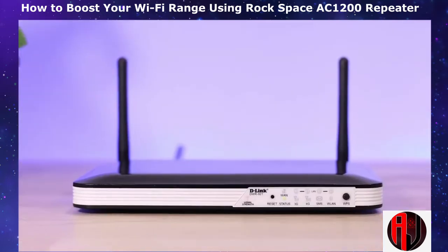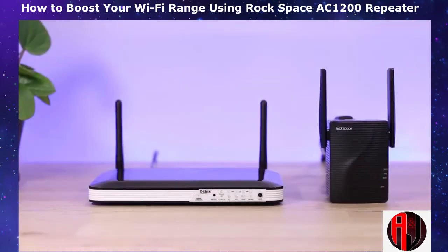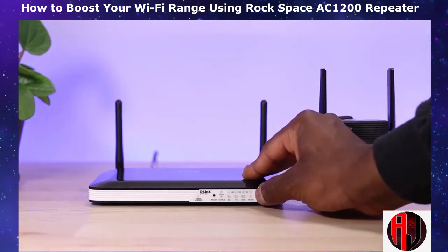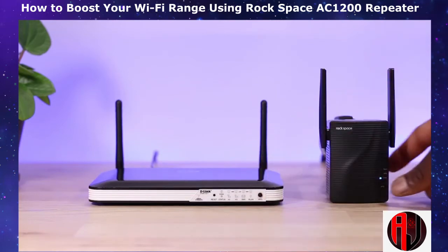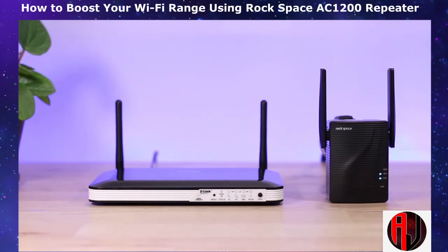To check if yours has one, simply look around it for a button either tagged as WPS or with a loop symbol next to it. If yours has one, the first thing you need to do is ensure that both your router and the extender are fully powered on. For the extender, you can tell it's fully powered on when the power indicator is steady and no longer blinking. Now press the WPS button on your router — for some reason I needed to press and hold mine for about 3 seconds. Then on your Wi-Fi range extender, press and release the WPS button and wait about 8 seconds, during which the two devices will pair up.